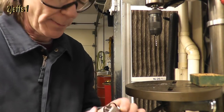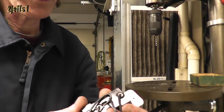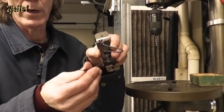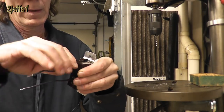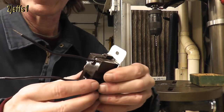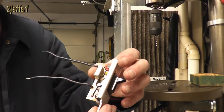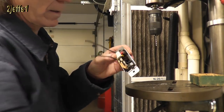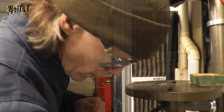Everybody likes bloopers — that was a blooper. Okay, here's what's going on now. Just straighten the wires out here, and make sure we get you in the shot. So what we're going to do is slide the rear cover off, because we've got to do one more rivet here. Now we're on to the circuit board part of it. And we've got to drill out the rivet on the Triac right here. So change the drill bit size and give her a shot.